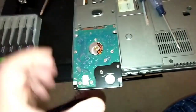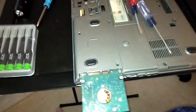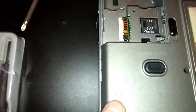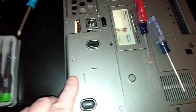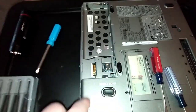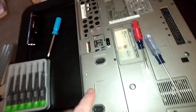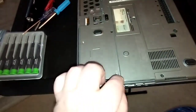If you want to put the plastic caddy back on, it's going to screw in on the edge — one side just clamps in and one side screws in. Then just bring your new SSD drive down in here. It's going to look a little different but the same size — the same footprint, like a little deck of playing cards. Slide it in, give it a push, and watch the screw holes line up. Don't push it in too far. Then hit your two screws.